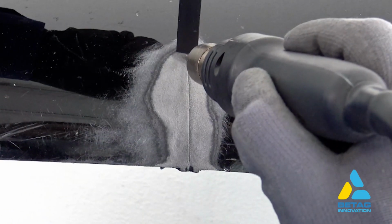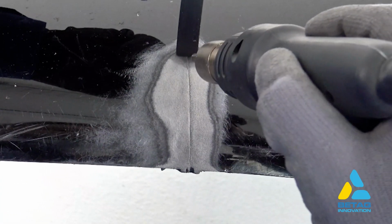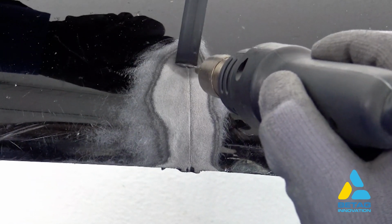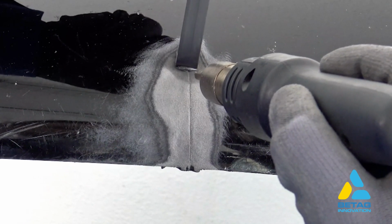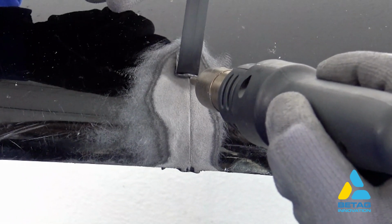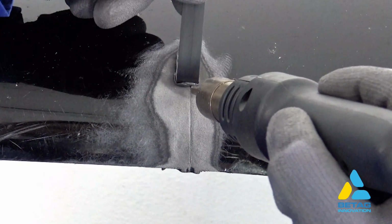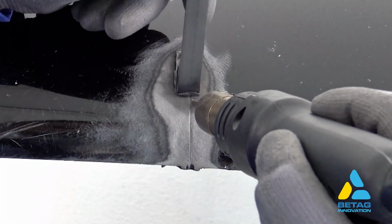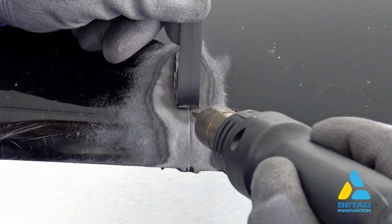The next step is to weld the outside part of the bumper using the same process. Slow continuous weld, and always applying the pressure. Make sure you get the little welding path in front of the welding strip, which looks like a small roll.